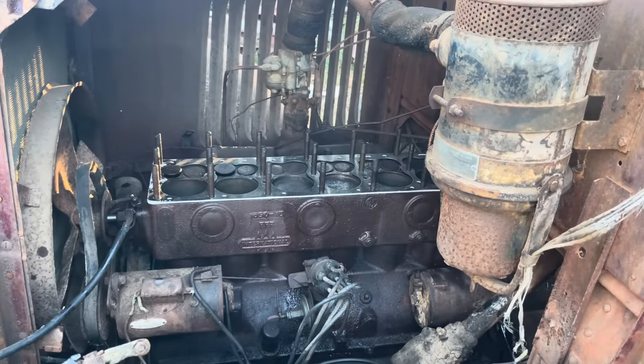Went ahead and took that tube off of there so that we didn't have to worry about whatever's in the intake. Our one spark plug wire here is kind of fancy. It's just a piece of wire, because I couldn't find another wire that was long enough around here. We'll fix that, though, once we get her running. Have everything hooked up to see if this old girl will fire off. Last thing we got to do is add a little bit of gasoline in the carburetor here. That should do it. We did fix that one plug wire, so now we have all 6 of them hooked up. And as long as the distributor works for her, she should run.